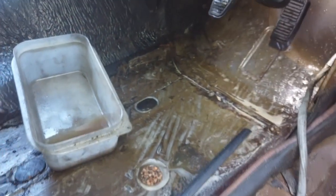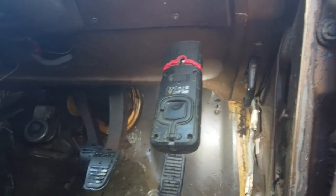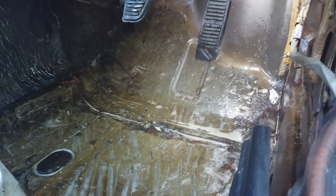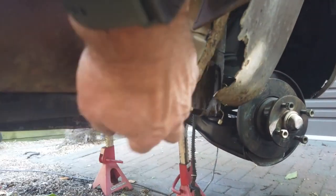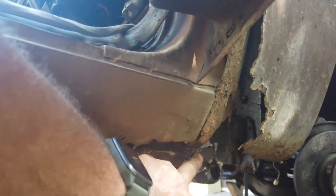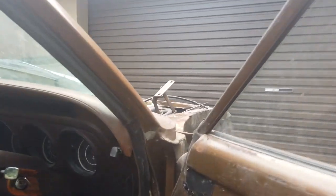Here it is - show you the bottle - NCS X-Rust. That's just helping - it'll also be getting put in the door seams as a primary operation before the rust converter and then the wax oil. My feelings on this: very pleased indeed. Outside you'll see the lower part of the sill has gone here - that's where we cut. We've got a donor section to go in, the wing's got to come off for this, so we attempt to repair the outer section where the jacking point is. I would say this is the better side.